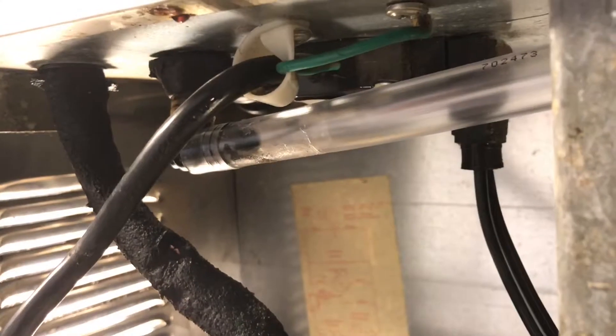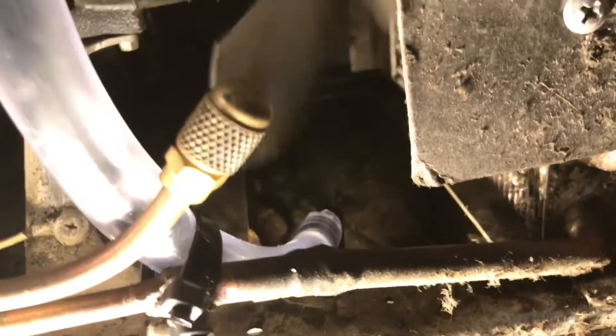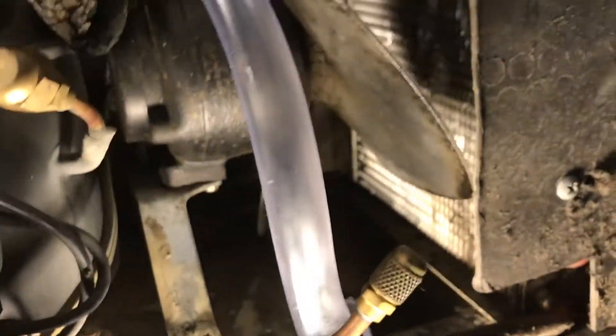I just completed putting in all the new tubing to help with the draining issue I was having with my True Refrigeration 4808 two-door sandwich making table. I went ahead and put the T fitting on this guy here, and instead of having the drain line go to the back and into the drain, I pulled it to the front and used two twist ties to hold it in. As you can see, I have plenty of clearance on the fan. I used two twist ties just to make it more redundant in case one were to fail.